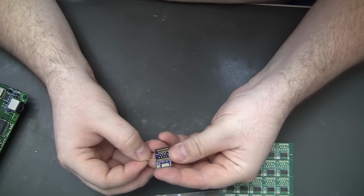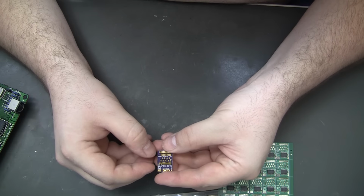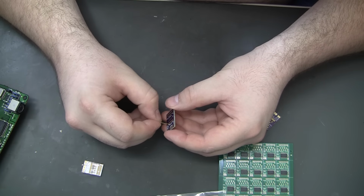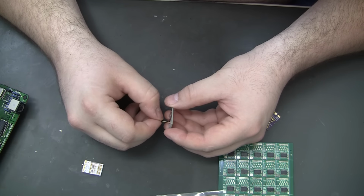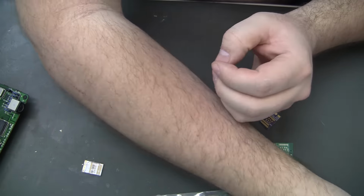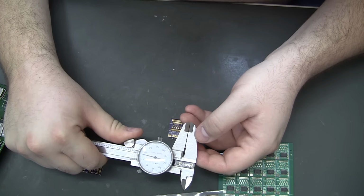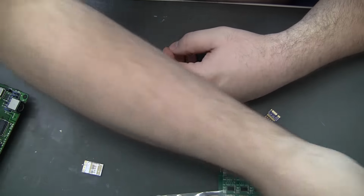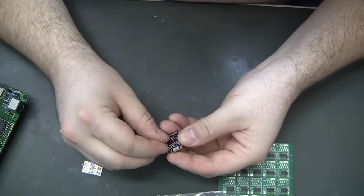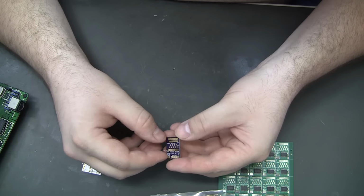We haven't tested yet to see how well these fit. I reduced the diameter of the hole so that those pogo pins would stay in there fairly straight, just to help me assemble and solder that. Yeah, that fits pretty well. I think I had to take it down to, I don't even remember, 25 thou, 26. I was worried that the manufacturing process wouldn't give me the actual diameter that I requested, and I've had that happen before, and just I'm setting in Eagle.